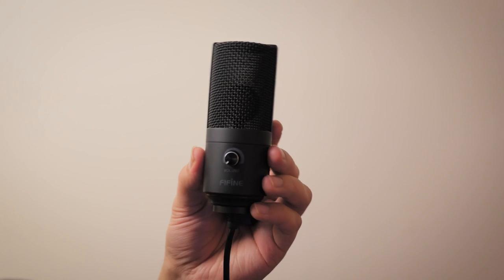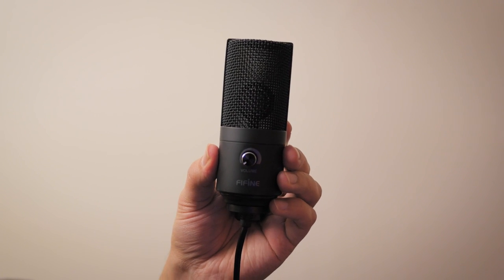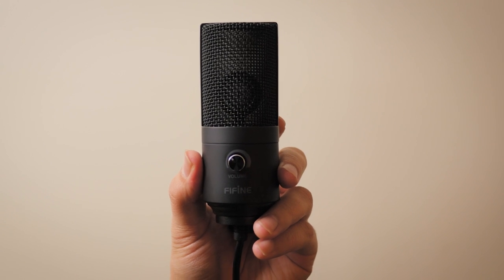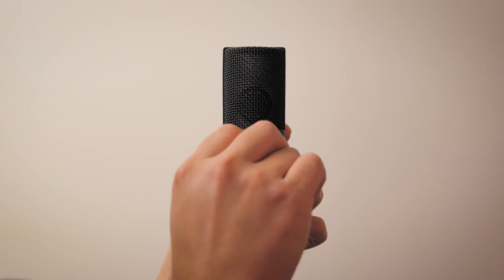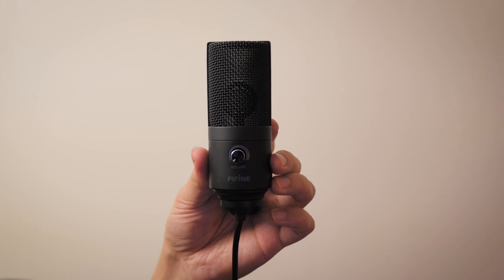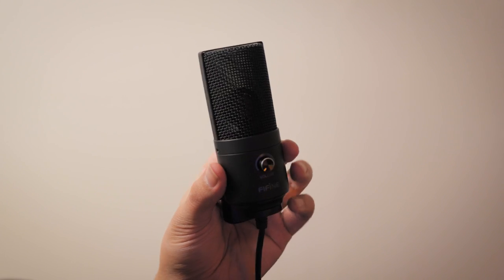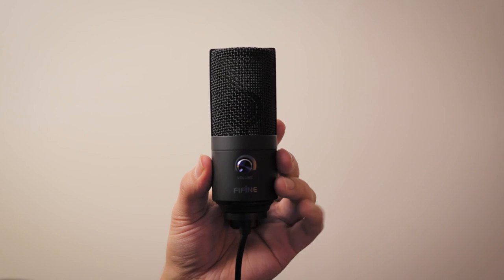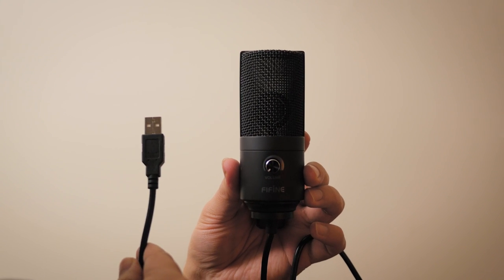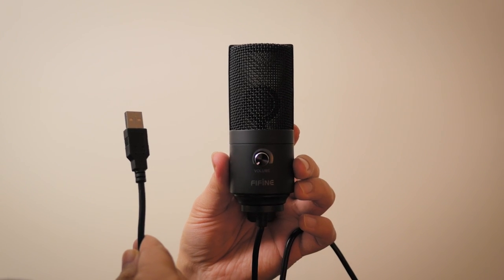The first thing you'll notice is its nice all-metal construction. It's not the most premium-feeling microphone I've ever held, but it's definitely not cheap-feeling either — it lands somewhere in the middle. It has a master volume knob on the front that controls the input gain and overall sensitivity, and panned all the way to the left it actually mutes it. It has a frequency response of 20Hz to 20kHz, measures at about 4.5 inches tall, and there's a 6-foot USB-A cable directly attached to the microphone.